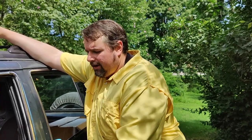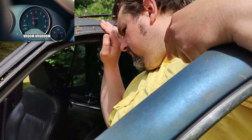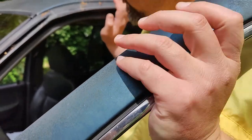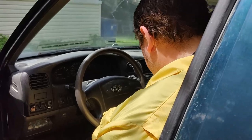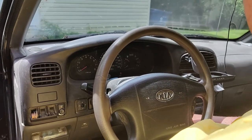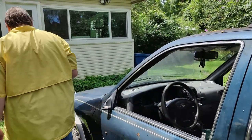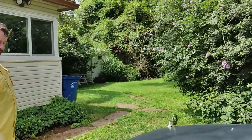Turn on your heater and it'll be fine. Maybe it is still a problem — it was idling for about 40 minutes and staying good and cool, then just started going up all of a sudden. Could be a bad thermostat. I do have a new thermostat. It's also not completely finished because the pressure washer blew. Anyway — it is better, it's not fixed. The thermostat may be a problem, but it is better than it was before.